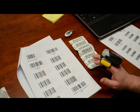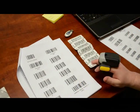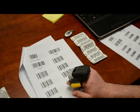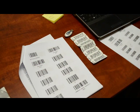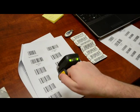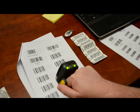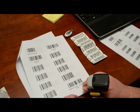This first page is usually where people mess up. If you do mess up, the best thing is to scan the factory defaults and start over. When you scan correctly, that high-pitched multiple-beep sound is good. I'll scan it again so you can hear what a bad one sounds like — that long, slow pitch is not good.